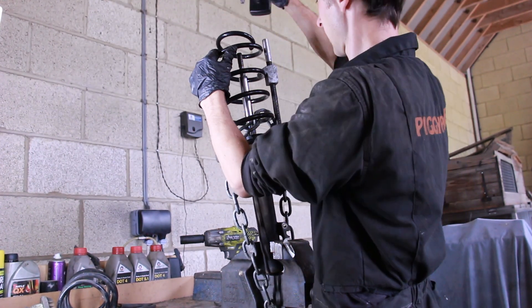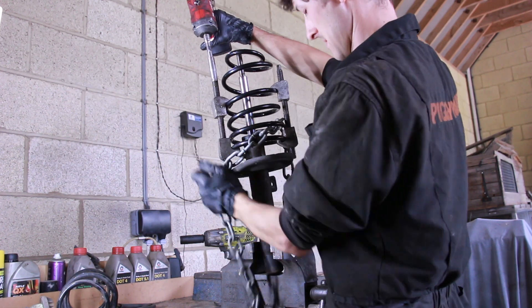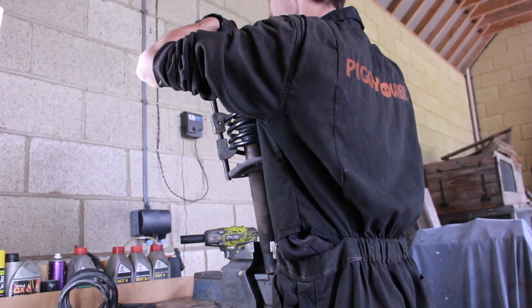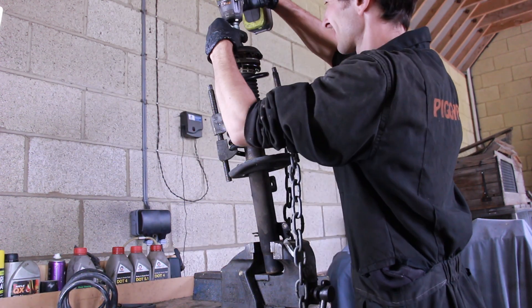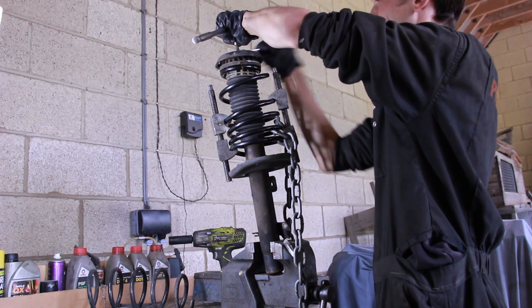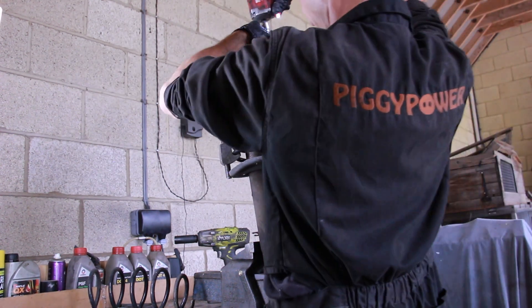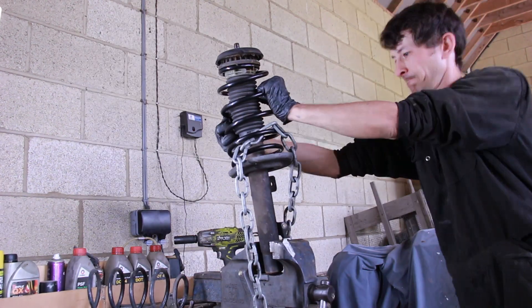We're getting our spring compressors in the right place. You want to get them as far apart as possible in length before you compress — you get the most compression from them — and at opposite positions, 180 degrees out from each other. If they're too close they'll slide round and cause the spring to be in an odd position. These springs are very soft and very tall so I had to use as much compression as I could get and then still had to squeeze the top on to get just a few threads. Make sure you get the order of all the parts in the right way, and if there's a top strut bearing that's worn out and grindy, replace it — about £10 to £15 and this is the time to do it. We then use the 7mm Allen key and the 19mm spanner to tighten up that nut in the middle without spinning the damper, torquing it to 75 newton metres. Gently and evenly remove the spring compressors, take the chain out of the way and make sure the spring is seated correctly.